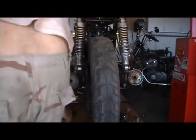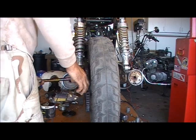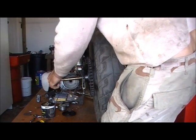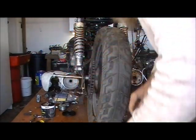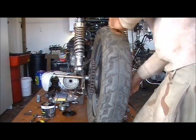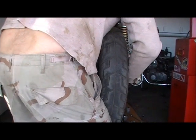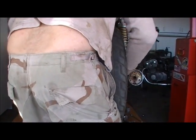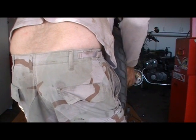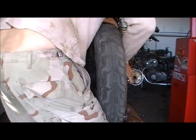Now, that's ready. Take my little chain adjuster right here. Just kind of hang it there. Come around here. Get that first bushing on. Just leave it hang there for a second. Get my other chain adjuster. Just leave it on top there like that for a second. Come over. Pick my wheel back up. And now I'm in this other bushing. Go like that, bring my chain adjuster down. Hope y'all notice I ain't using nothing but my finger there.